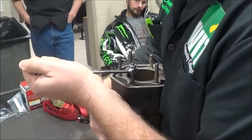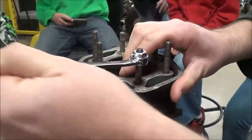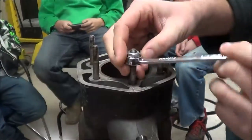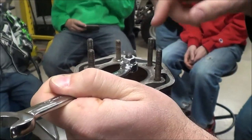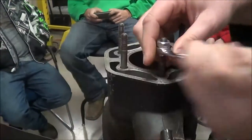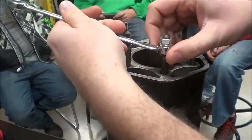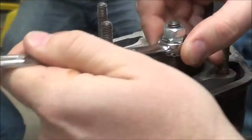The whole stud is turning — this one didn't take any heat. What's happening is by turning the bottom nut, it hits the top nut so tightly that it takes the path of least resistance and removes the stud. Be careful not to drop the stud into the cylinder — you could stuff a rag in there if concerned. You could use a ratchet wrench only if it's coming out nice and easy.